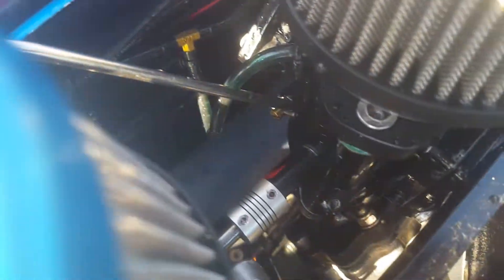Like I said, there's one screw on each carburetor for the low end. The high end is back here, and it's the same way — we're going to lightly screw them in, find out where they're set at, and then screw them back out.